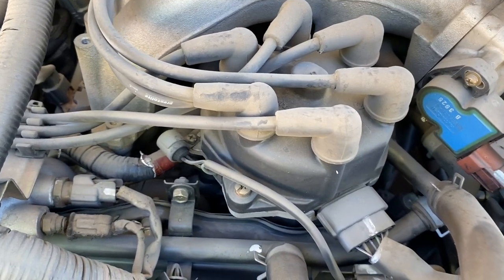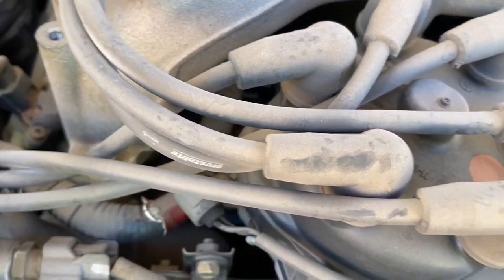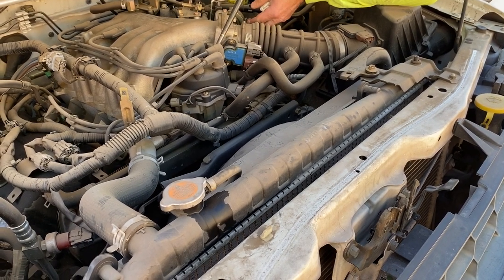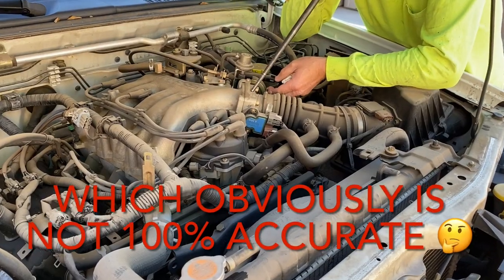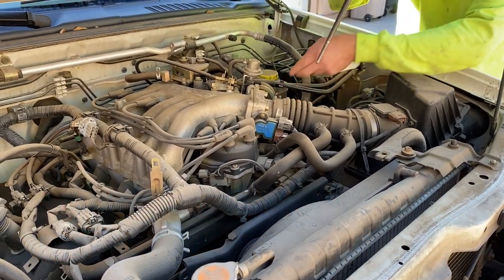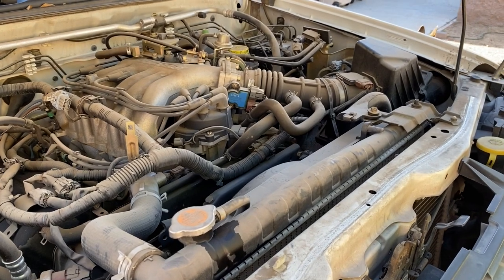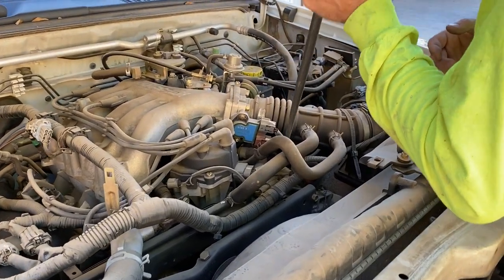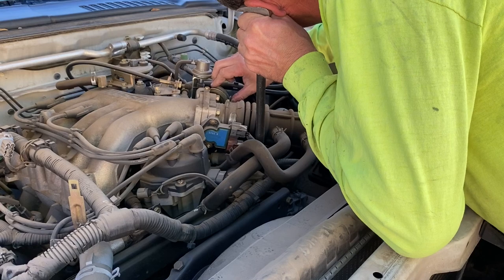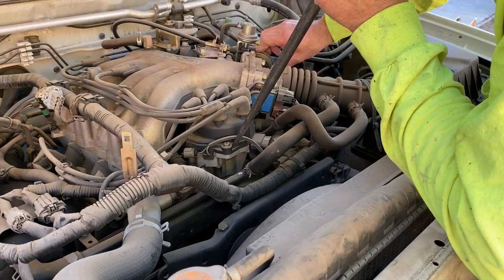Right here I'm going to let you listen to that noise I had coming from the top of my engine. Just by the noise I could tell it was coming from the top of the engine somewhere. The easiest way to diagnose where a noise is coming from is to grab a solid piece of metal — I'm just using a heel bar. Move one end around on various things on top of the engine and put the other side right to your ear; that will resonate the noise. Don't use anything with a plastic handle because that will muffle out the noise. When I put the heel bar on the distributor it was the loudest I'd ever heard that noise, which is why I was almost positive it was going to be the distributor.